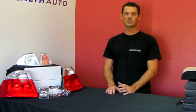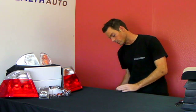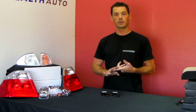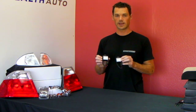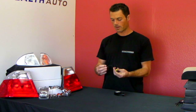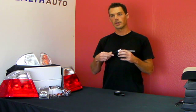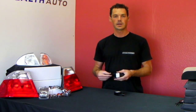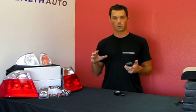One more thing about our HID kits — and please excuse me if this video is a little choppy, I'm editing a few shots together from throughout the day. If you have a newer car — BMW, Mercedes, Range Rover, and all the Chrysler, Dodge, and Jeep vehicles — I highly recommend getting a set of our anti-flicker HID capacitors. These capacitors run in line with the system. Basically, they intercept the kit and the stock wiring harness and trick your factory system into thinking it is the original 55-watt headlight installed, as opposed to the new 35-watt HID kit. This will eliminate any bulb-out warning errors, flickering, or strobing that happens because the system is expecting one voltage and it's getting a different one.